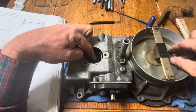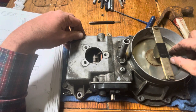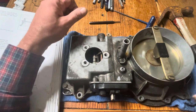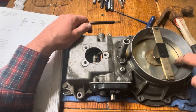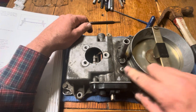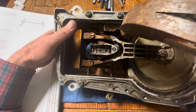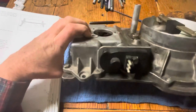All this does is change the relationship of where this plate actually hits the piston and when it starts to press. What you want to do is press here and hear the fuel flow already at this point — then your engine is going to start every single time. You can then do all the other adjustments, but this is the very first one. On a lot of cars those plates are going to be off. With just tapping this part in here you can adjust the height; if you go too far, you just take your hammer and go back the other way. Don't overdo it.